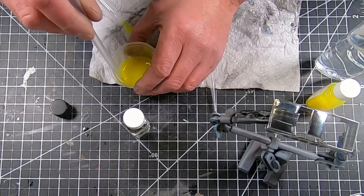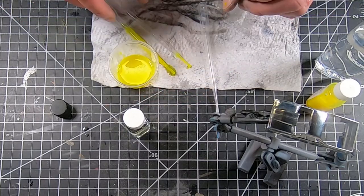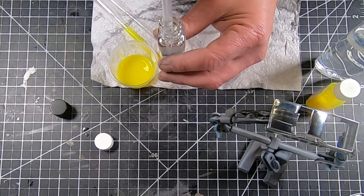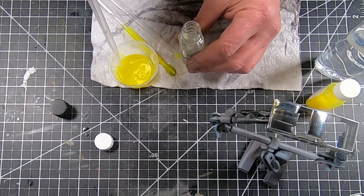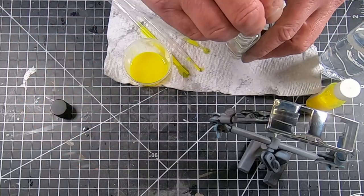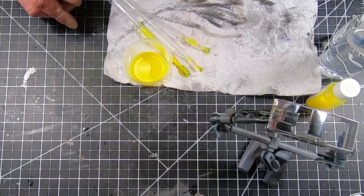I have a system and it works for me, and I hate to deviate from that on paint. Then I mix it up. I think the hardener is three parts to one — I put like one and a half in just to help it. And I always wipe the top because when you put the lid on, you'll never get it back off again if it's got any residue on there.